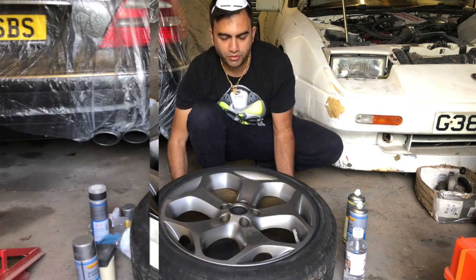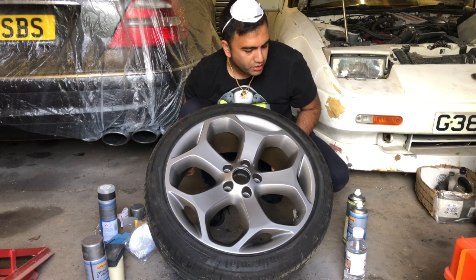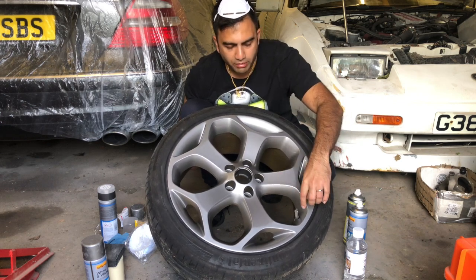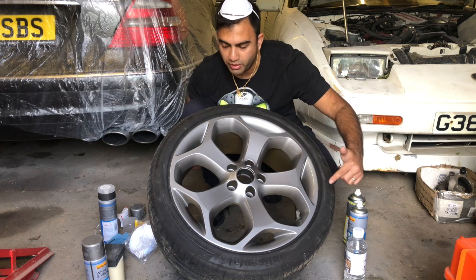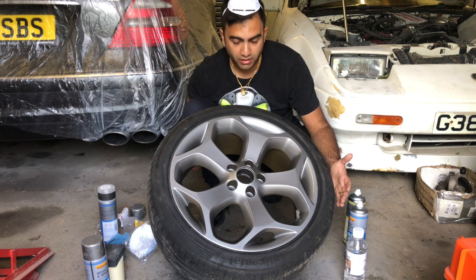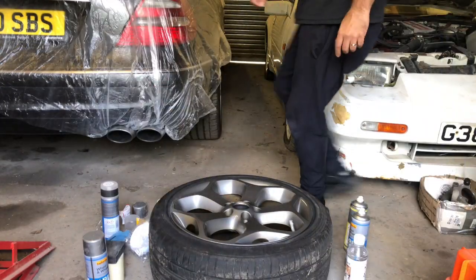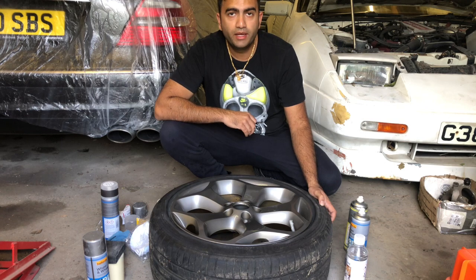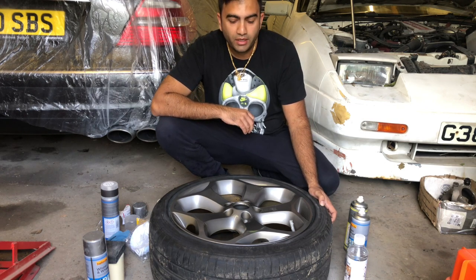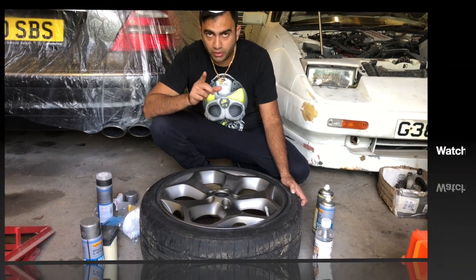I'll position the camera more directly on the wheel so you guys can see how the finish comes out. There are a few speckles here, but once it's fully cured and dry, give it a wipe over and go over it with 2000-2500 grit wet and dry sandpaper. This is one heavy coat of lacquer — I don't think it needs another one. Now I'm going to remove all the masking and give you a glimpse of the finished product. The masking has been taken off — not too bad a finish. I'll just let the edge area dry a bit more because if your hand slips taking the masking off there, it will ruin the paint. No paint on the tires and didn't deflate it. We'll let this cure for about an hour and then it'll be ready to go back on the car. Thanks for watching — keep an eye on the next video where we are remapping an Audi A6 Black Edition TDI, and then we'll be going on a road trip, possibly somewhere in Europe. Thanks for watching guys.